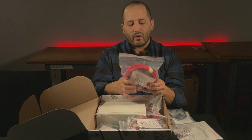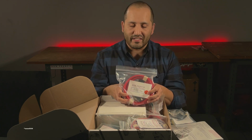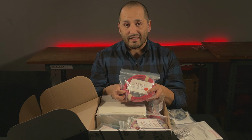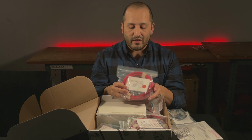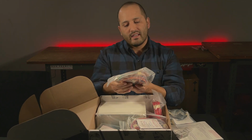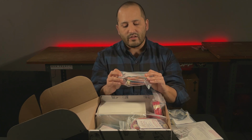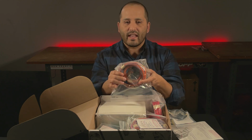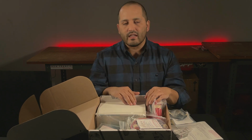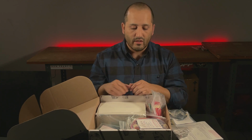This is the alternator wire. So I'm running a high amperage alternator in my vehicle. I bought like a 140 amp police interceptor type of alternator years ago. So I'm reusing that. That's been turned into a single wire. So that's pretty cool. And this is the starter distributor wiring. Love that everything is individually packaged well with instructions, and it has all the connectors too as well. Awesome. I'll be using an electronic distributor for my Cougar when I get to that point, so that's kind of neat that that's able to hook up to that.